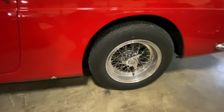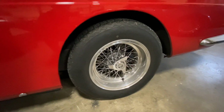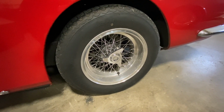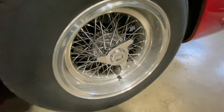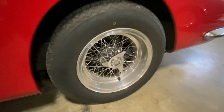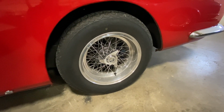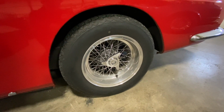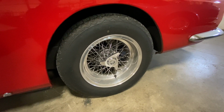But before we get into that, I should remind people that what they tell you to do with knockoffs is you should always knock them or hammer them while the car is on the ground. It takes stress off the bearing. When the car is up in the air and you try to knock on this ear, you actually can put stress on the wheel bearing. So when the wheel is on the ground and you hammer it, it doesn't take as much stress against the axle as if it were up in the air. All that stress that you hammer onto the hub transmits right through to the bearing. So that's the first tip.